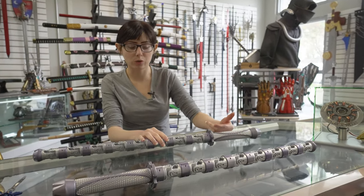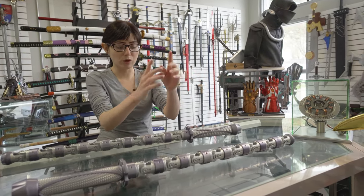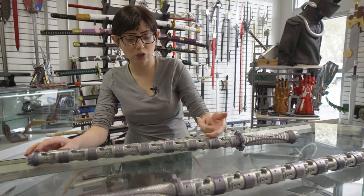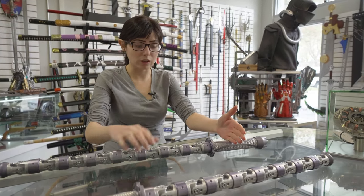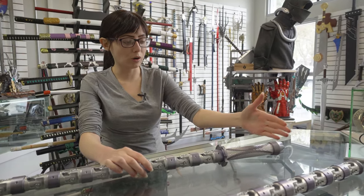You have that clear plastic piece — you have to make sure it's going the right way. The flat piece goes on one side; the tubular, pointy-looking part goes here because it's supposed to concentrate the light going into the rods. Then you have the other component, a little green thing, and that connects everything — the bulb goes on the flat side.